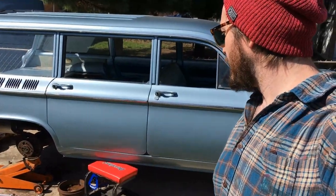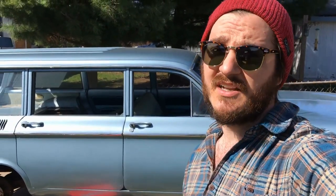So the day has not gone well. While taking things apart, the wheel cylinders on this were so rusty, no matter how much penetrating oil I used, not even heat, I could get the bleeders out. I ended up breaking off the bleeders in three of the four wheel cylinders, and I even tried to weld a nut to them, but the welds kept breaking, so it wasn't working. So it looks like I got to get four new wheel cylinders. I've got four of them on order with Clark's Corvair parts, and should have those in hopefully by Wednesday. If I get those in, I'll get back on this and things should go in a whole lot faster than they came out.